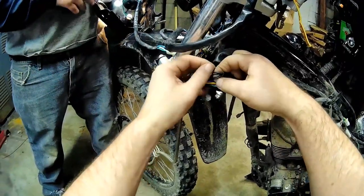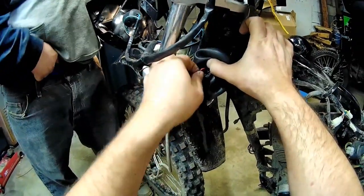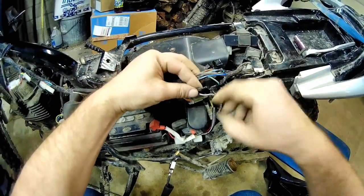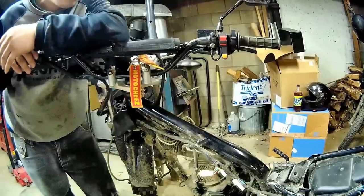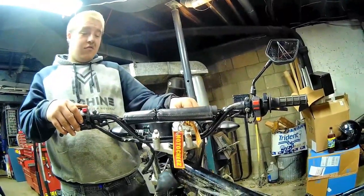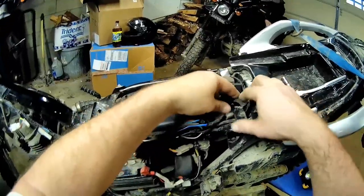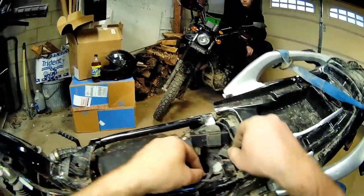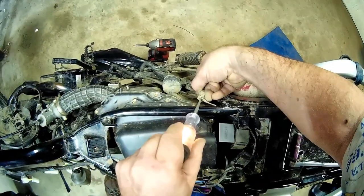The only thing I can't see is where all these black wires are connected. Here's a bunch of black wires connected together — they're all going forward, and then there's one black going back. There's a splice here. Power comes all the way back to here — that's the flasher, that's the blinker. One goes down to the brake switch, and that's getting power.